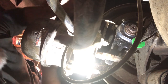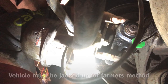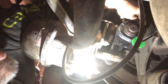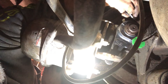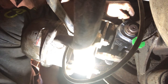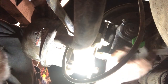Your wheels will roll freely. The automatic slack adjuster is going to put it where it wants it anyway. This brake is adjusted. I'm going to pull the parking brake and see if it goes out and if I can move the wheel by hand.